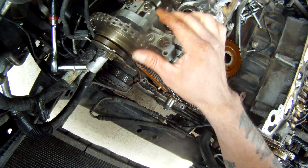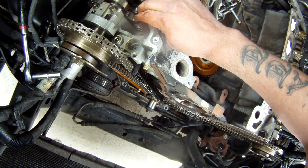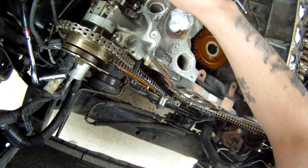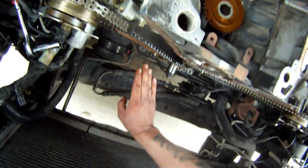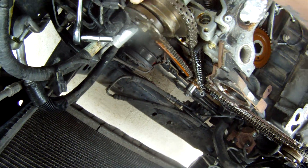You'll notice that cam spun — don't freak out if that happens. We're changing the camshafts and all that other stuff, so when we put all this back together there's going to be a special procedure. That's going to involve loosening these cams, making sure all the valves are up, resetting this engine — and it's going to be interesting how we do that. I'll make sure to make a video to show you that.